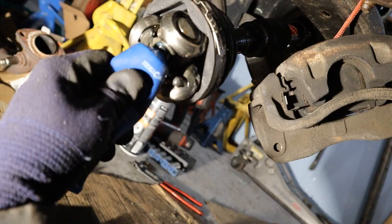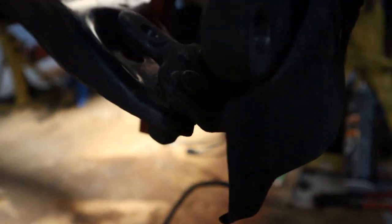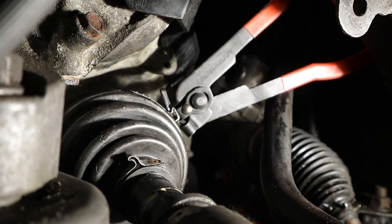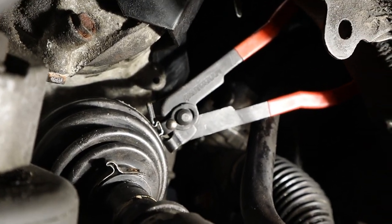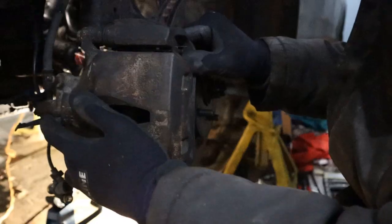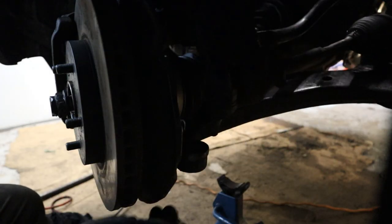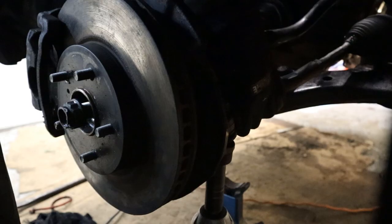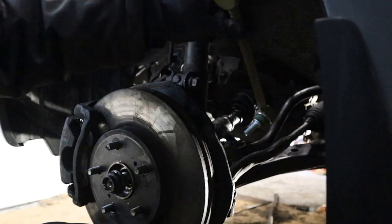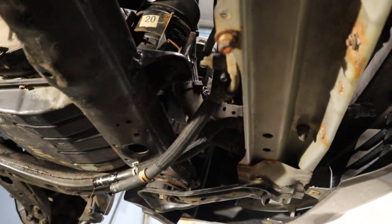Back up at the top I have got the lower ball joint connected to the lower control arm, and I was able to shove the axle back into the transmission. I have got the OEM-style clamp on there from the boot kit and my crimping pliers have squished that connection. Now I am going to replace the brakes and put the caliper on, also replacing the ABS sensor and the tie rod, putting the nut on the bottom. I am installing new sway bar end links — these are TTX brand from MevoTech.